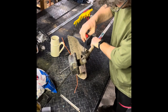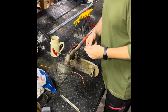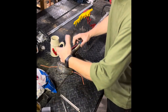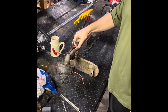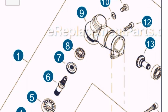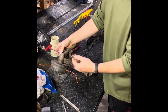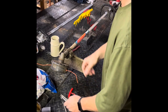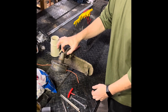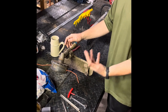Metric 4 millimeter — we're going to break this one loose and back it out. When you're doing your service, always check this gearbox for tightness. They will start to work loose and flop around in here, and I've seen lots of these shafts that were tapered from the gearbox spinning in place. Occasionally I would try to rebuild one — there's like a little pinion gear in there that meets another gear, and there's just two bearing stacks. Look at a parts diagram and you'll see it's very difficult to get a part, and labor is so high.